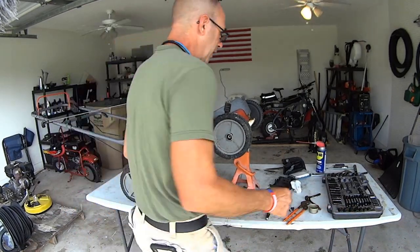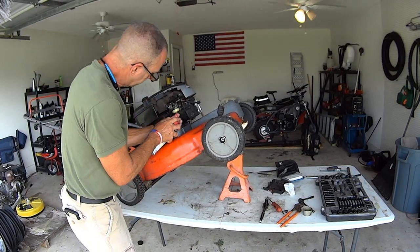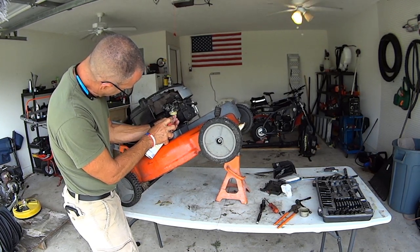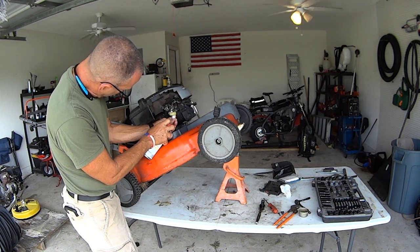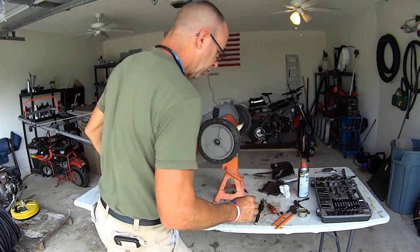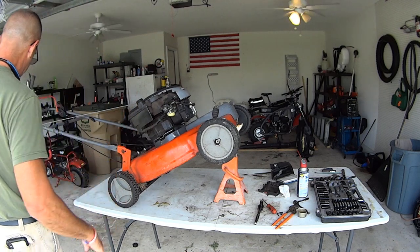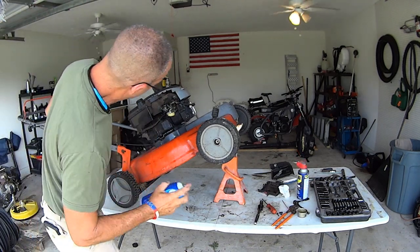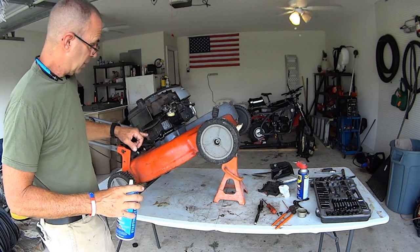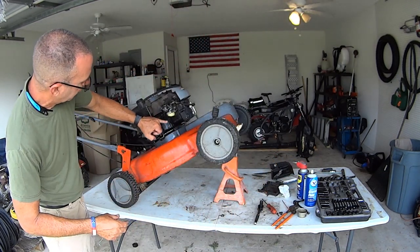So we need to clean up till we have a good flow. Good clean flow. Pretty much anything that has a tube, WD-40, will loosen the dirt. Really anything. And that's all that we're trying to do. Not trying to fill up the cylinder, just spraying a little bit in there, let the WD-40 get in there, and it'll loosen, and you can take your starter fluid and blow it out. There you go, nice. Oh, I saw it. Yep, it's passing up. I have every bit of confidence that if there was something clogged in there, it's out now.